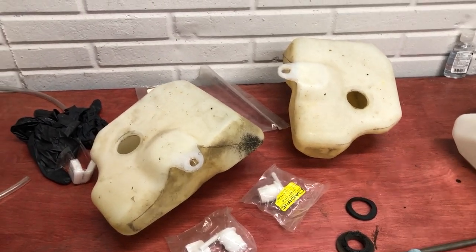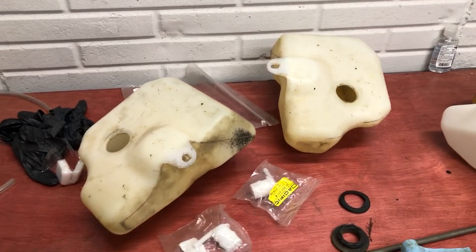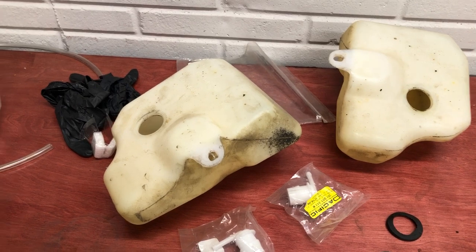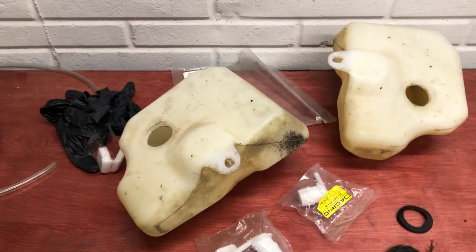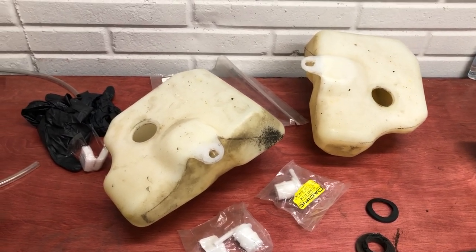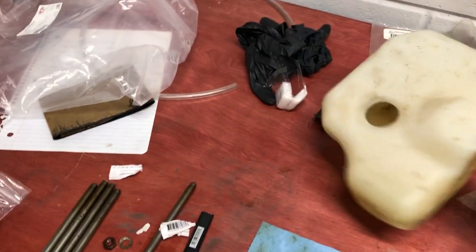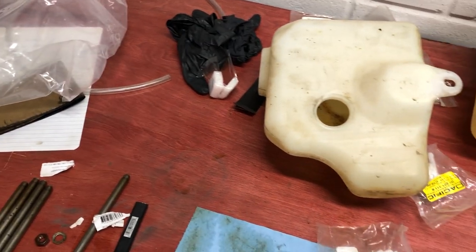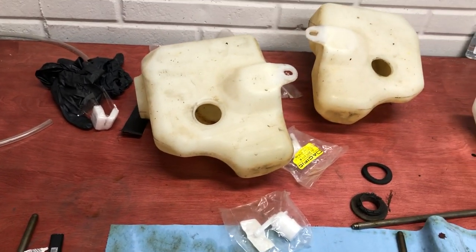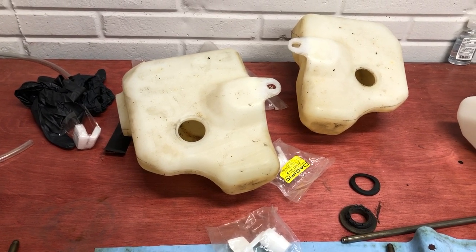Another public service announcement. As I mentioned earlier, I got water contamination in my fuel, and I believe the suspects are right here in front of us. These are the fuel evaporation tanks and they live inside the front wheels of your Vanagon. What happens is there is a rollover valve that goes into these holes and they are secured with rubber grommets. If yours is anything like mine, they have probably been in there since the date they rolled off the assembly line.